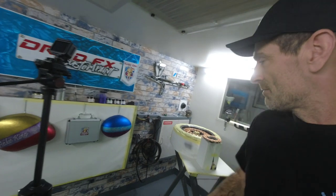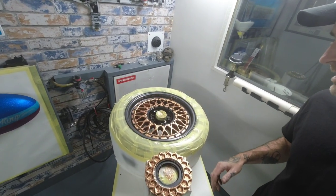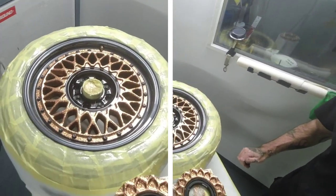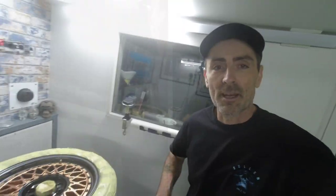That's the end of the video. I gave the alloy five coats of clear, with about 10 to 15 minutes between coats — a nice flash time — and kept checking the masking tape to see how tacky it was before putting the next coat down. As you can see, that's nicely covered the metal flake, nice and shiny with a good gloss on it. And that's your centre piece, and then you've got your centre cap which bolts on in the middle.